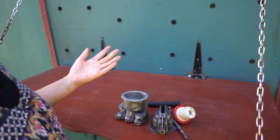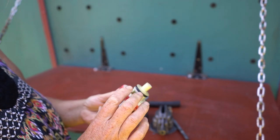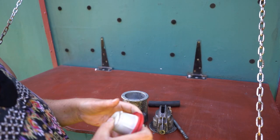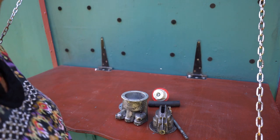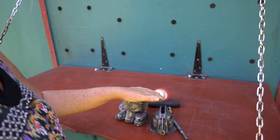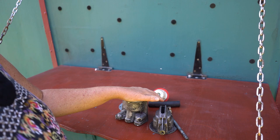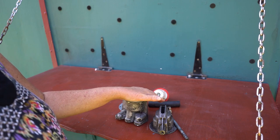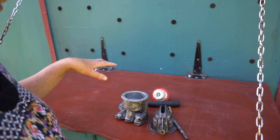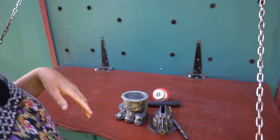I highly recommend what we did. I don't have much faith in putting plastic under that amount of pressure, especially old plastic — this truck was built in 1977, so this plastic bit has been working as a handbrake for a very long time. All trucks of that age group are going to run into the same sort of problems. If you can get a good one, whack it in, but if you can't find one, it's probably worth spending extra and getting something better — the new one should last forever because they're a lot simpler now, with a sliding valve instead of all these springs.